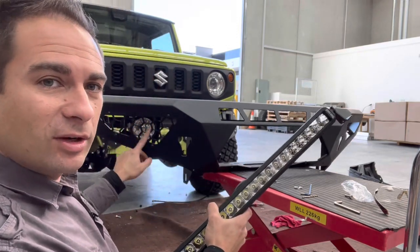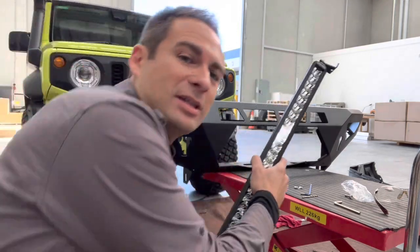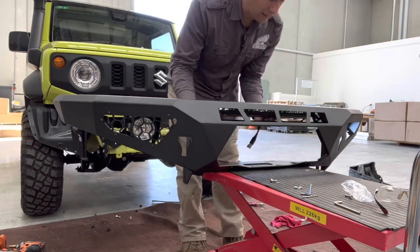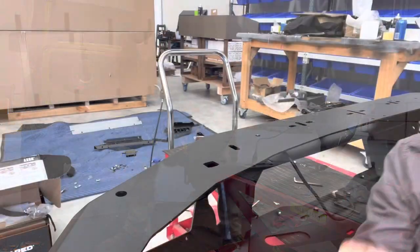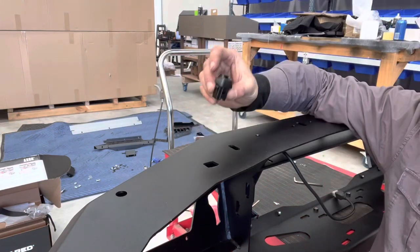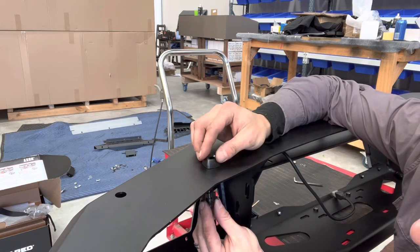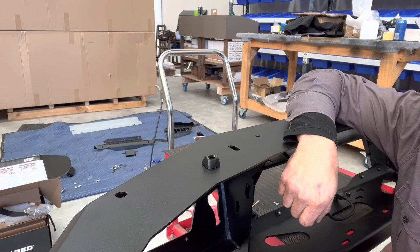Then we're going to put the grill on with the fog lights. I've already done one side; we'll do the other side — this is quite easy. Once you put the brackets on the light, just put it in and do up the bolts. To put the headlight washer in, basically just push it in from underneath. Done — we'll plug in the hose and we're good.